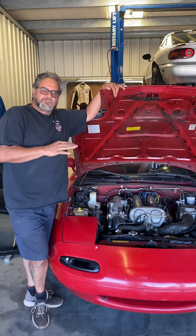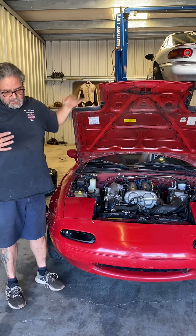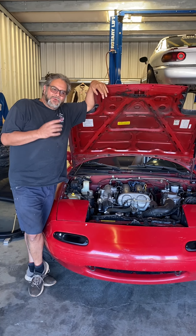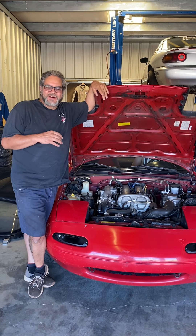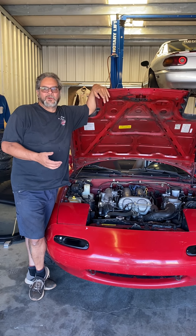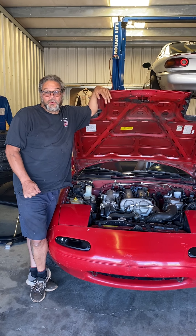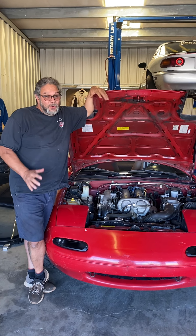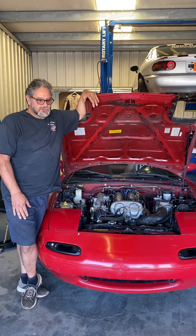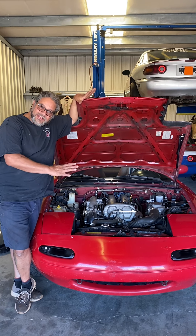This is a great platform to start off racing. The problem I have racing a 1.6 car is that I can't make the weight — it has to be 2,275 pounds, and I can't strip the car light enough to be competitive. The horsepower is around 100, and if you've got one putting out 120, you're doing pretty good. Torque is around 100 pound-feet. Kids coming out of karting are screaming fast in these cars. So that's the first generation NA 1.6.